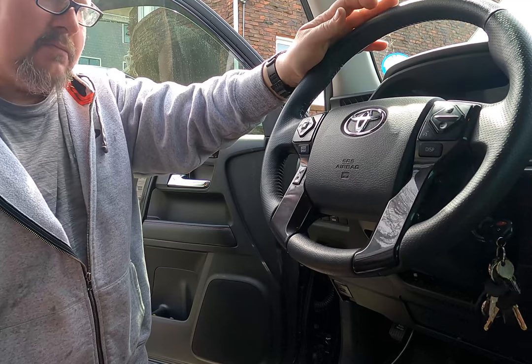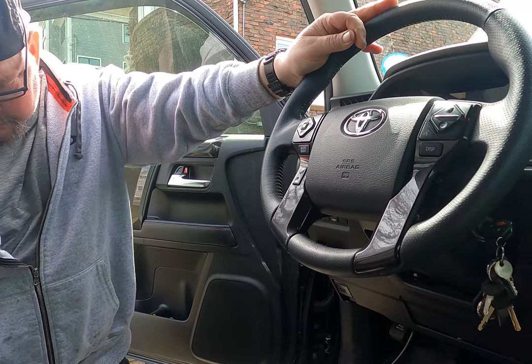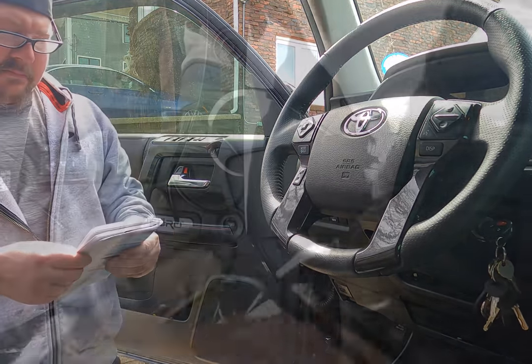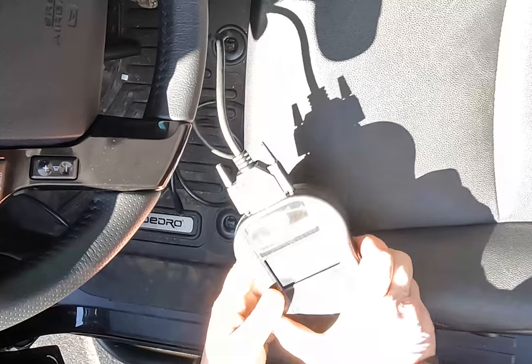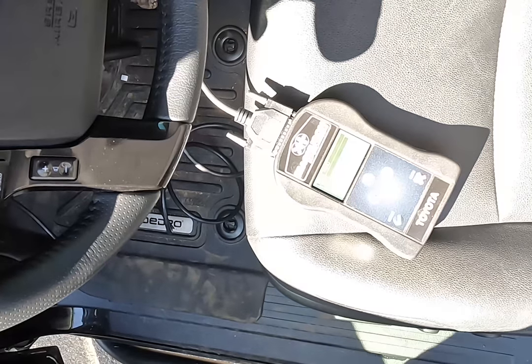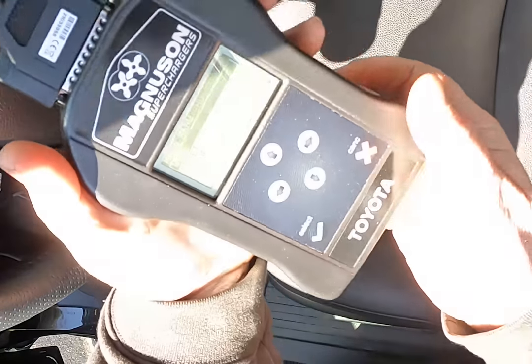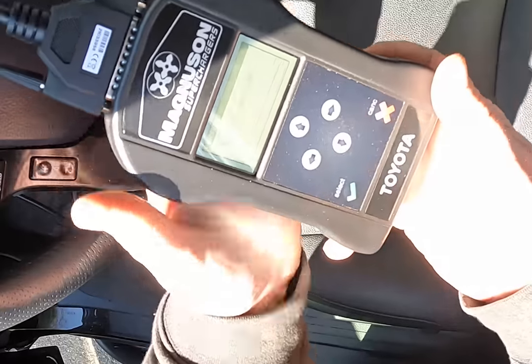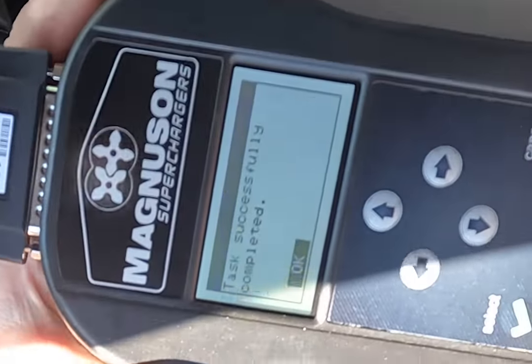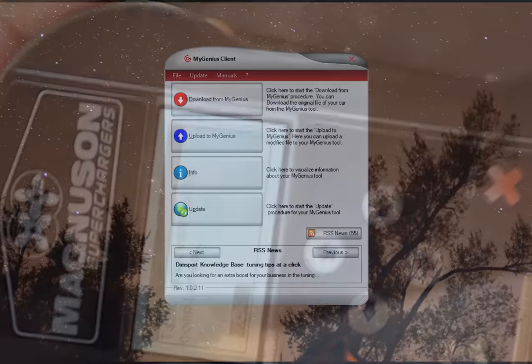Once the correct serial protocol has been identified, select OK. The identification screen will display. Select ID. Once again, you'll be prompted to turn the key on, but don't start the vehicle, and then click OK. It's pretty easy. The device will begin to read the ECU at this time. It'll say Wait, starting communication. Again, turn the ignition key off and hit OK. After task successfully completed is displayed, select OK and unplug from the OBD2 port on your truck.